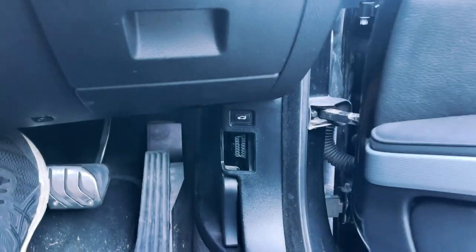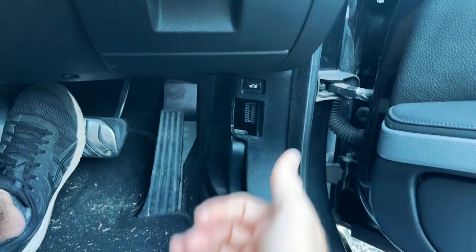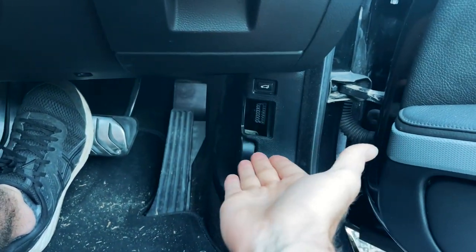Unfortunately, the only reason I can't do it is, I can't remember if I mentioned it before, but the JB4 blocks the signal to a Bluetooth USB dongle. So when I have my MHD adapter or any Bluetooth dongle in there, I can't use the JB4. So for normal driving, that's no good, because the JB4 needs access to all that data.